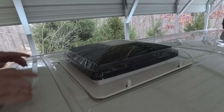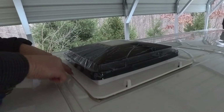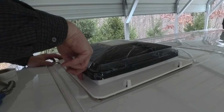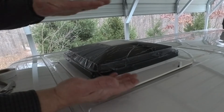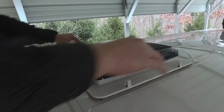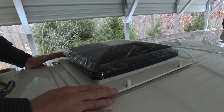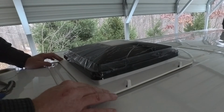We're going to put up some wood framing on the inside. And basically what I'm going to do is pre-drill these holes through the metal roof. And then the screw will grab the wood square that is around it, and that will draw the whole thing together and clamp it tightly. You could just screw to the metal, but then you're going to have those screws hanging down that you still have to deal with. You could cut them off, then it loses some of its hold. So it's better to let the screw just go all the way into the wood.